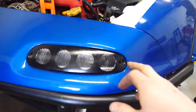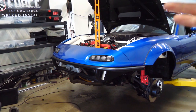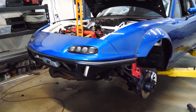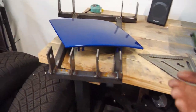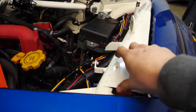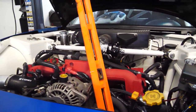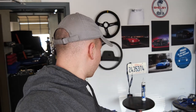For now I'm going to leave the circle pattern on these lights - let me know what you think: I can leave them as is, make them clear, or tint them black. Now we have to make some brackets to hold the lids to the hood. I think I'm just going to rivet some pieces of aluminum to hold it together so that when you open the hood you have more access. Right when I started working on the lighting again, the alignment bolts got delivered, so we're going back to working on suspension. We'll mount the headlight lids in the next video.